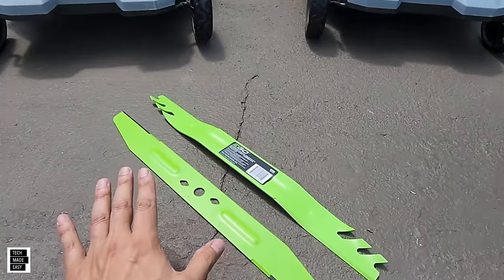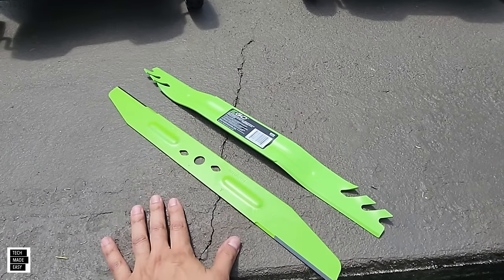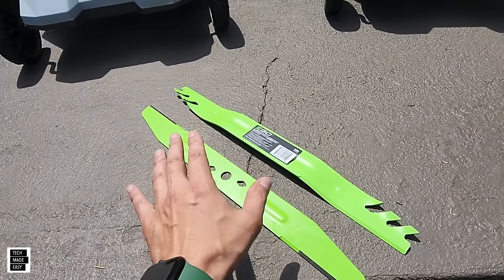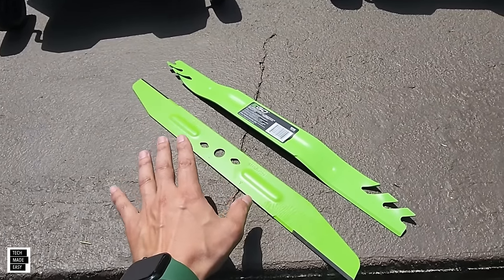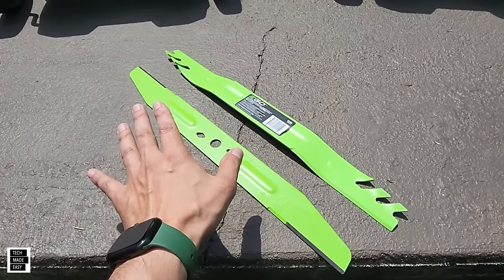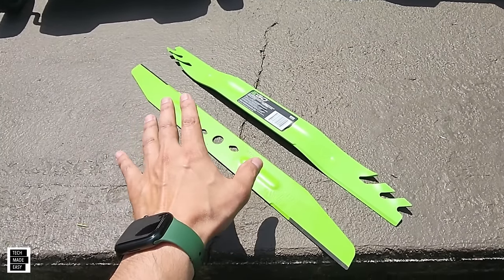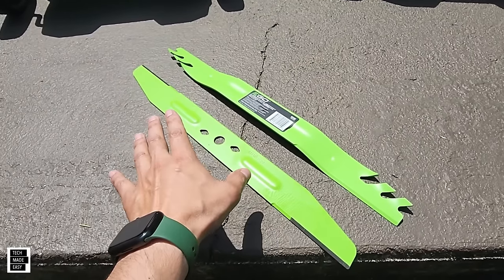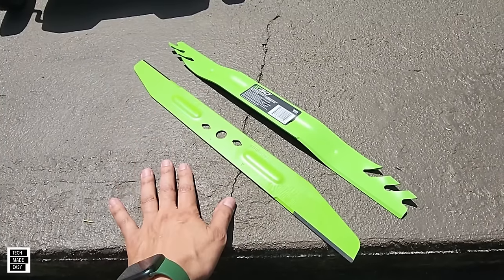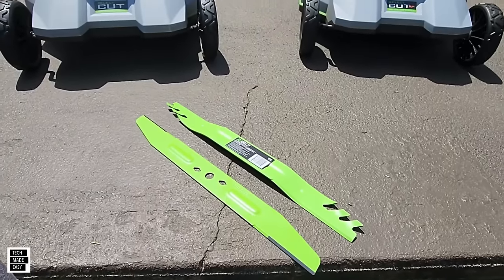Here's the blade everyone should have — this is the mulching blade. This set is AB 2101D (link in the description). This blade basically cuts grass into finer, smaller pieces, which is great for feeding your lawn. The use: it's great for a weekly cutter, someone cutting maybe up to two inches of grass, looking to mulch and leave it on the lawn. Pros: it's an aggressive blade that cuts through thicker grass creating smaller mulch sizes. Cons: it uses more battery, needs sharpening more often, and will not bag well — if you're looking to bag, look at the next blade.